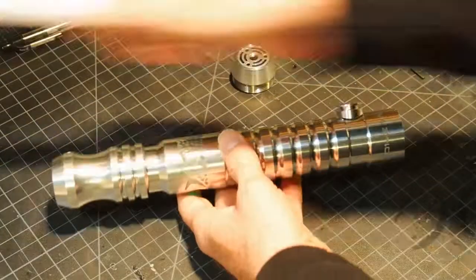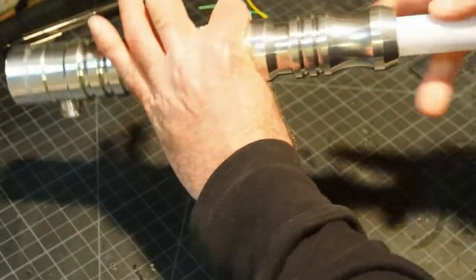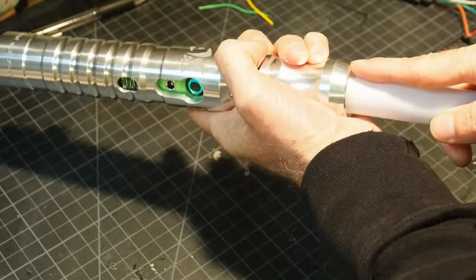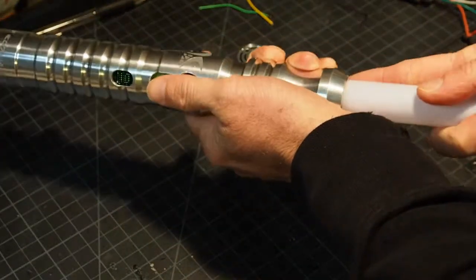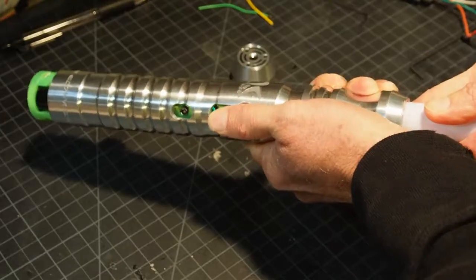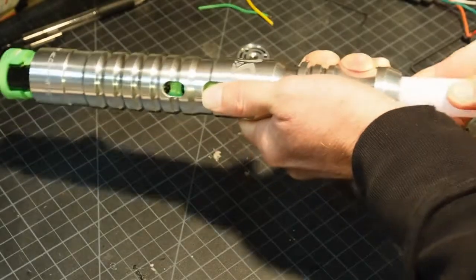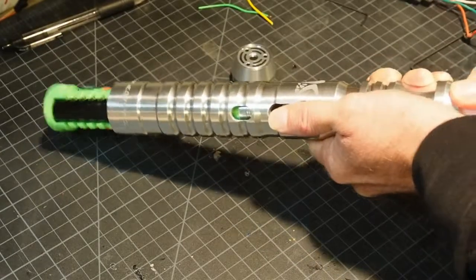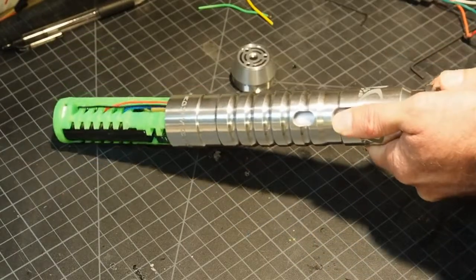There's no two ways about it. So again, I'm taking a plastic cylinder, a marker will work. The retention screw is out, the kill key is out. I'm pushing on the metal, not the lens. Then I can very gently push it out. And always push, never pull. You may need to push on opposite sides of the lens just so it doesn't bind up on you. And it'll push out.